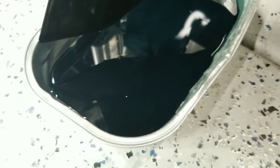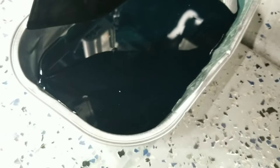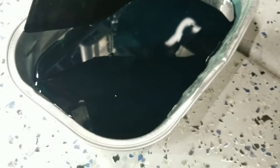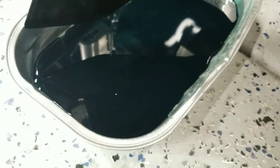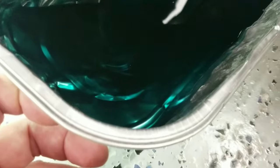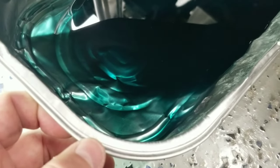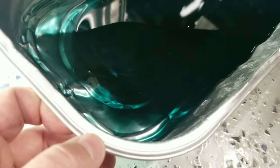This is your gear oil drain. What you want, if you're using the Mercury gear oil which is a bluish-green color, is for it to be transparent and really clean looking. If it looks milky or brown, that means you've got water in your lower unit and probably your shaft seal or the seal below the water pump is leaking. See that real beautiful transparent blue color — that's what you want. If it looks anything other than that, you may want to replace your seals or take a look at the seal underneath the water pump.